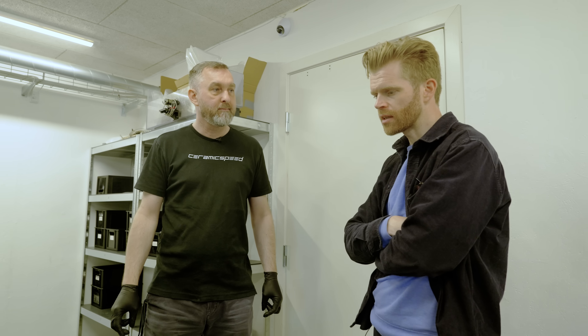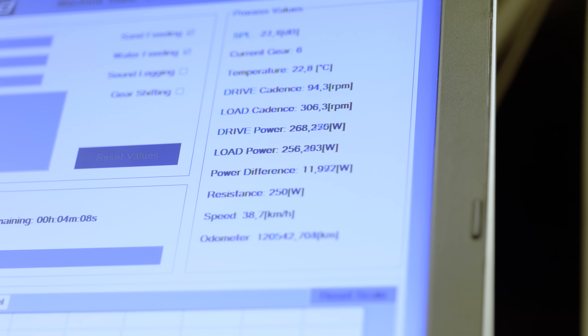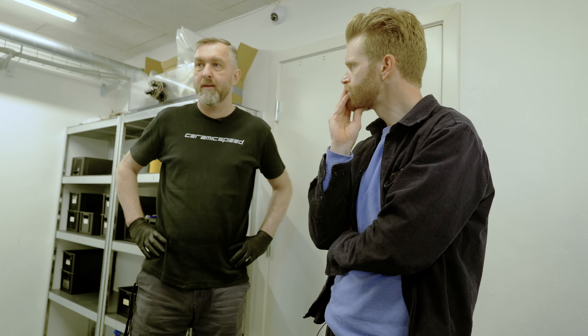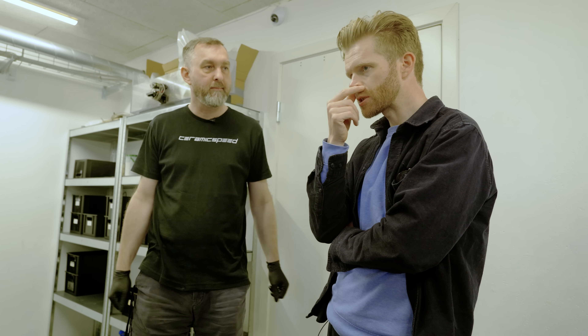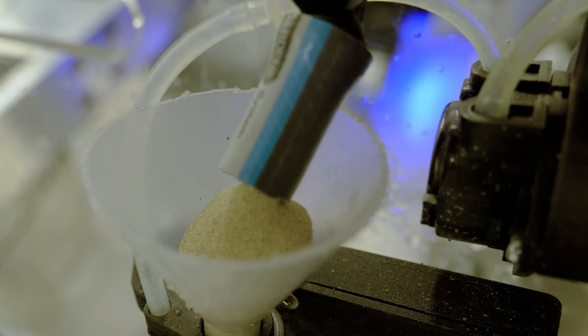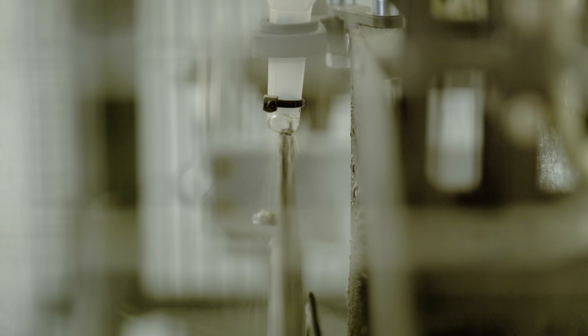Let's hit it with the sand as well. Right now this is going up and up, reading about 12 watts. A cyclist putting out 250 watts is losing 12 watts of that just being consumed within the drivetrain. If we fully optimized everything — chain and lubricant — maybe seven watts would be realistic. With the sand and water progressively applied, we've got up to about 12 and a half watts, which is quite a lot.